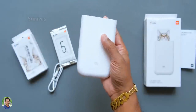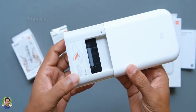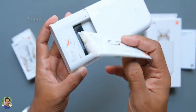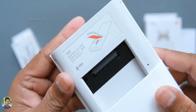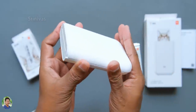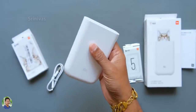You can download the app and install it, then connect via Bluetooth. You don't have Wi-Fi, so you can print in remote places. When you open the cover slide, you load the paper. You have an orange calibration sheet — you will put in the orange sheet first. The perfect colors, paper size, and printing are correct when you calibrate it.